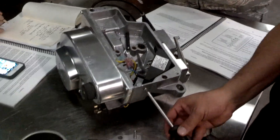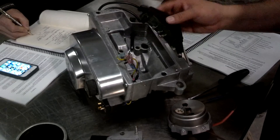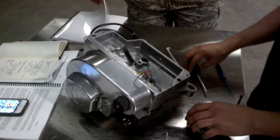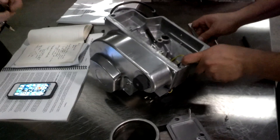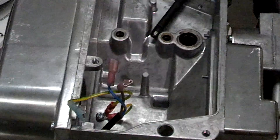To take the transformer off, you back out the two screws that are holding it, and then the transformer comes right out. Now that I have the atomizing chamber out, the only thing left inside of here is the photocell. You can see how the photocell sees light and sees the flame through this center hole here.